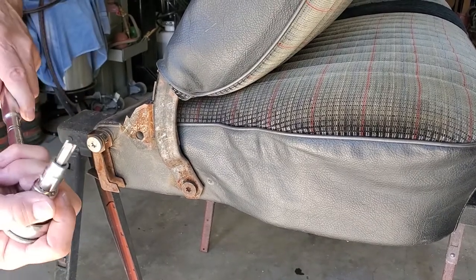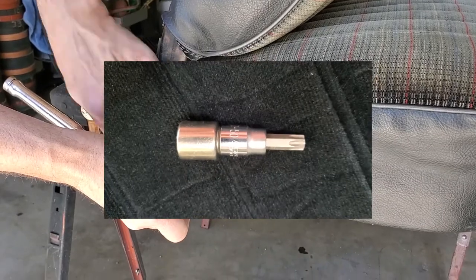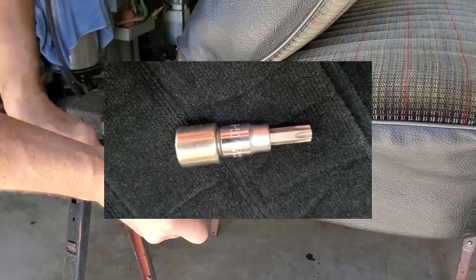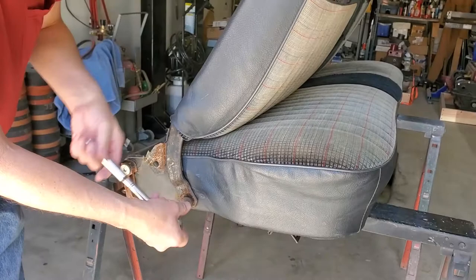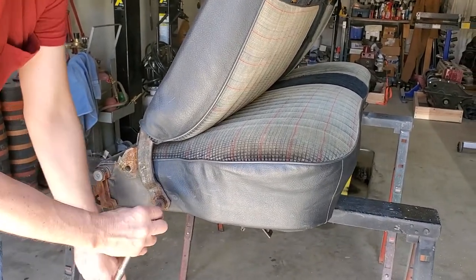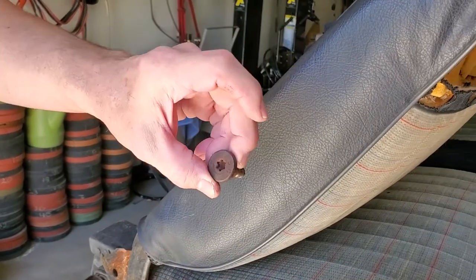So you need your star driver, and that's a 3/8ths. You're going to have to remove one fastener on each end — that's going to take the top seat cushion off of the bottom seat cushion. You'll really have to go pick up on these tools. It's also the same tool that you use for working with the seat belt system in the vehicle. It also has a nice pointed end, so it's very easy to install.